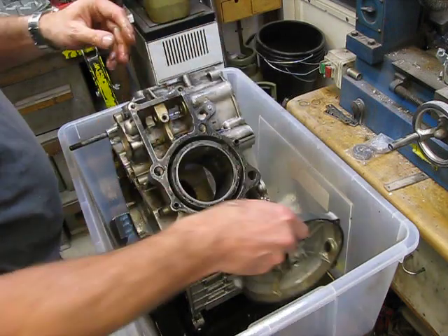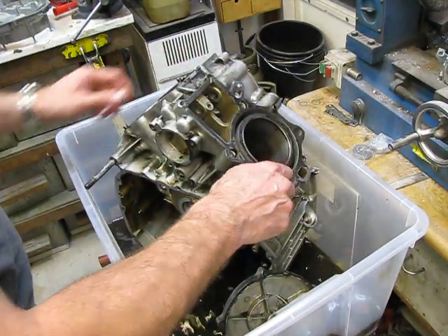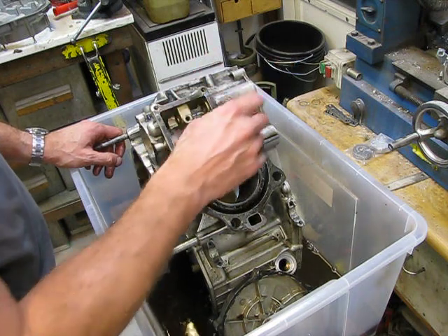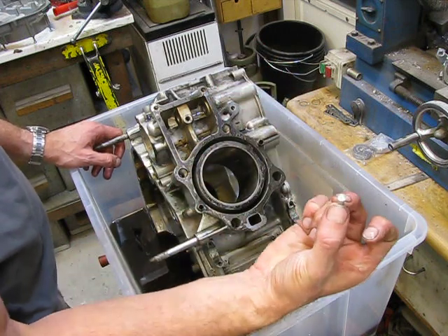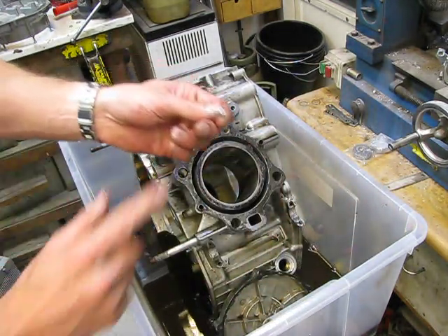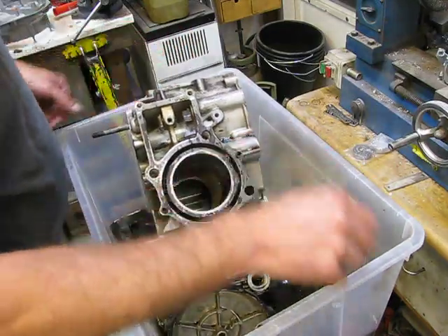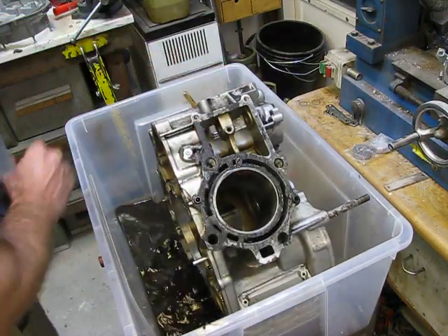So let it soak in the gasoline — petroleum, petrol, whatever you call it in England, I really don't know. Then this oil passage — normally I can pick them out only by clamping a strip between my nails and pulling them out. I never throw those away; I always keep them in store. But sometimes they are a little bit tight and you can't get them out. When you take a plier or something like that, it won't work. Let me give you a little tip.